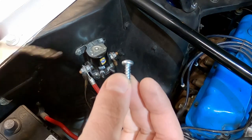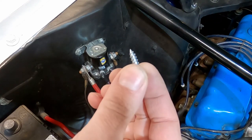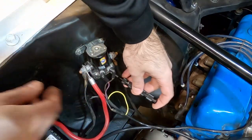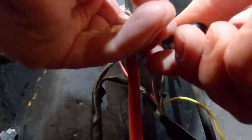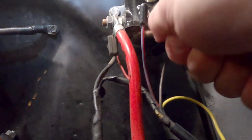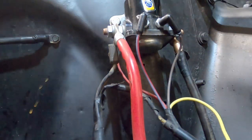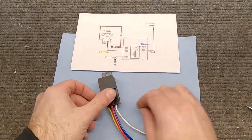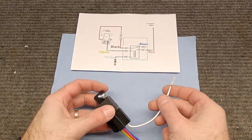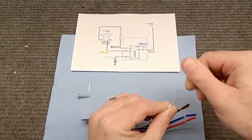This is the screw I'm going to use to hold that on there, so we just need a drill bit that's a little bit smaller than the screw size so we can make a hole that will grab the sheet metal. It makes it easy if you have a punch — you can mark on the sheet metal where you want that hole to be. I want to tuck this underneath here, so we just put the punch right around here and mark the sheet metal for where we're going to put the drill bit. For the ground wire, we're just going to use the same screw going into the sheet metal and ground this wire to that, using the white wire as ground.